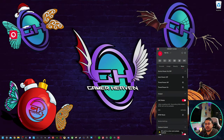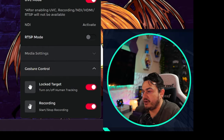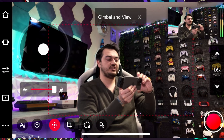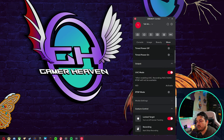The important tip I didn't find in any YouTube videos or the instruction manual: if you want this to work as a plug-and-play webcam — just plug in via USB-C and have it recognized in Zoom, Discord, and OBS — in the application, click on the 'More' tab, come down to Output, expand it, and you will see 'UVC Mode.' Click that on. You'll get a little box pop-up and it'll cut off some modes but allow the camera to be used as a plug-and-play USB webcam. What I really don't like about this application is you cannot full-screen it or freely resize the window.